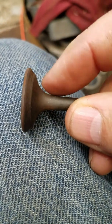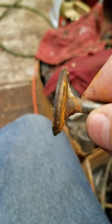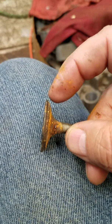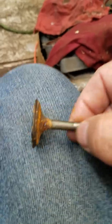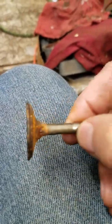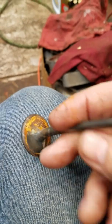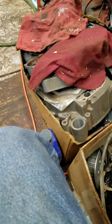See this profile here, this angle — it looks good, it looks straight. That's still a pretty good looking valve. That's actually the exhaust valve that came out of this engine — I put new valves in it while I was at it. It had moisture on it. If you look real hard, you can see this surface is cupped out — it goes up and then it swoops and then back up. It's hammered from sitting there pow-pow-pow, hammering on the head. It distorts it. You'd take it out, show your customer — look, your valves are hammered. So you put new valves in and recut the valve seats if needed.